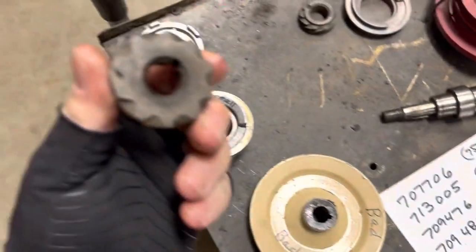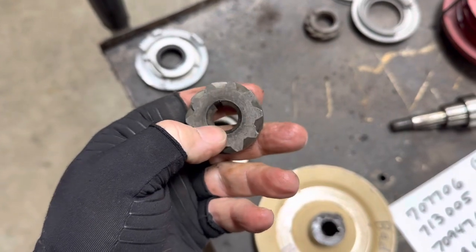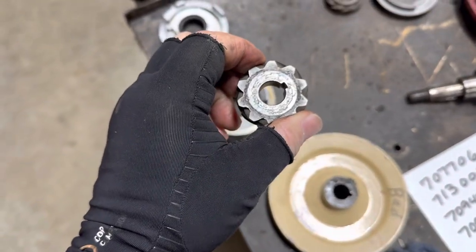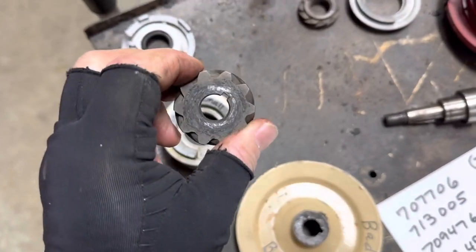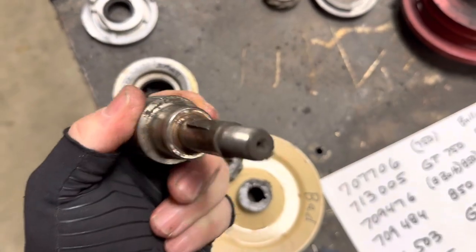The last thing to look at is the front end parts. If we have a mixer engine, this gear is going to be different — it's going to be just one little curved area cut, tapered inside, with the keyway cut. That's an easy way to tell: it's got a keyway, and it's going to fit your mixer keyways.